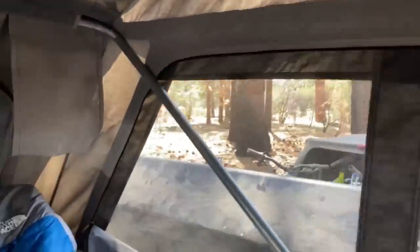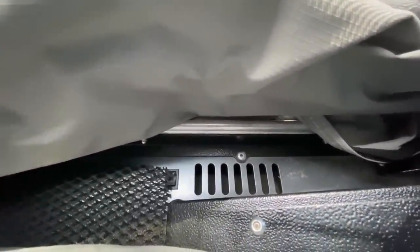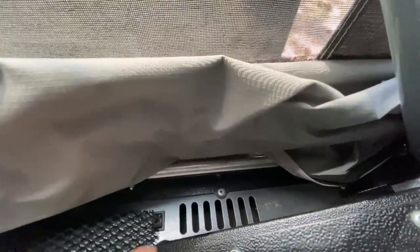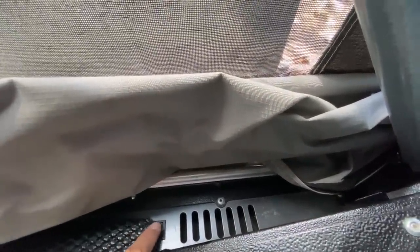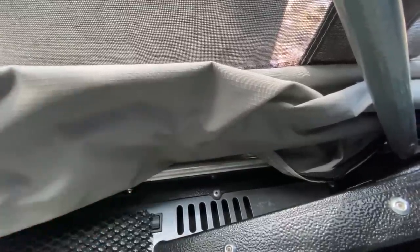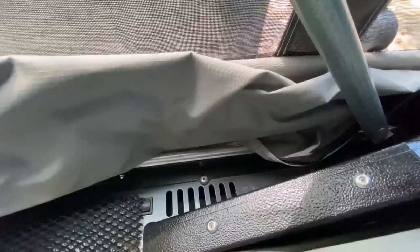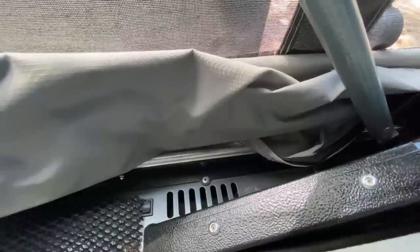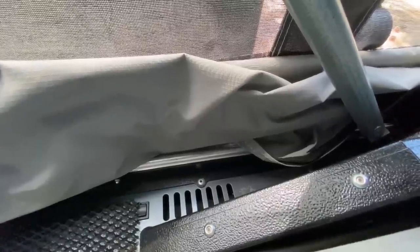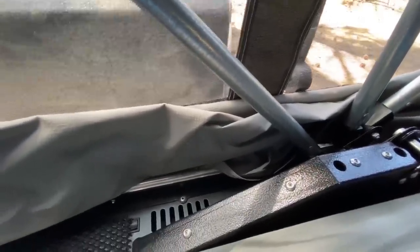There's a vent down here. So this switch here that you can see right there, that turns on the vented heat that comes into the tent area. So there's a fan in here where as soon as you hit the switch, there's a couple of modes. There's a slow mode and a fast mode. When you have the diesel heater running, the Webasto, it'll pump warm air into your tent. Now, it's not strong enough necessarily to heat up the kids' room as well as the main tent. If you just had the main tent alone open, then it'll probably do the job. We've camped in the 20s before, and you still need to bring a buddy heater. It's not strong enough to heat up a tent in that type of temperature. But if you're in the maybe 30s, 40s, it'll make the room comfortable for sure.